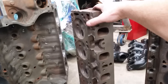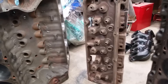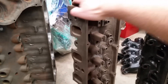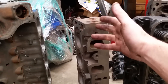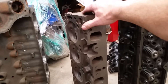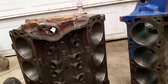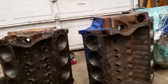This is a Modified head, so it's a smog head, but it's very similar in design. If you wanted to make a 302 Boss, there's a guy in town here that actually cuts the water jacket hole and machines it — they have a special manifold — he blocks this off, fills this in, and actually puts these heads on the 302 and makes a replica of a Boss 302, even though it's not the original casting number or anything.